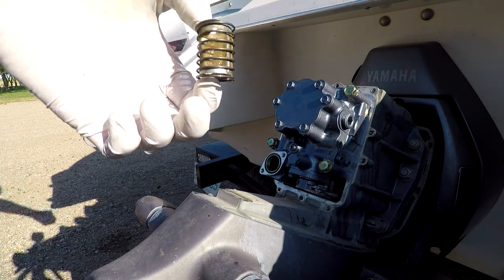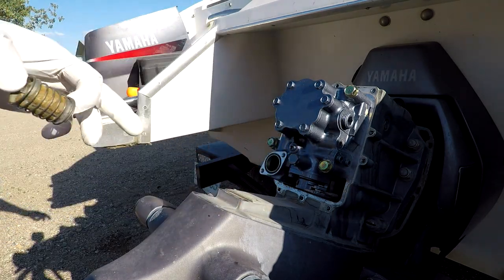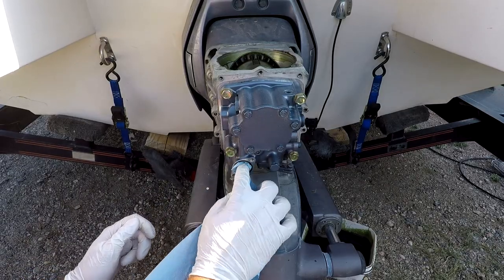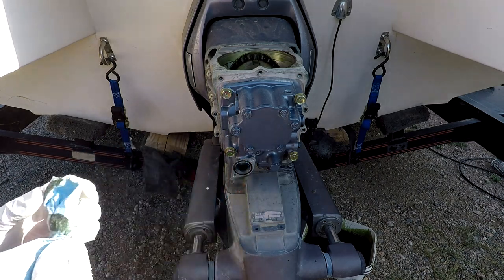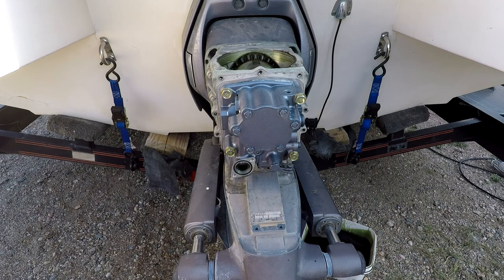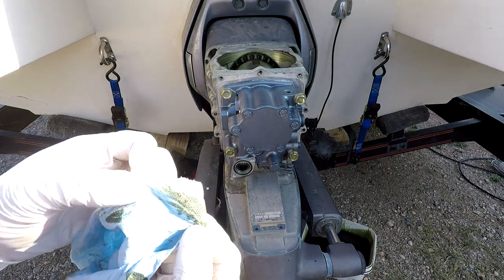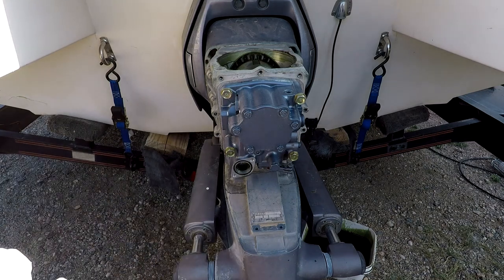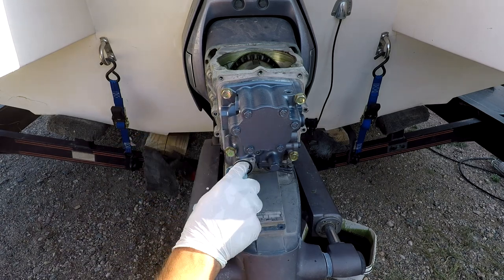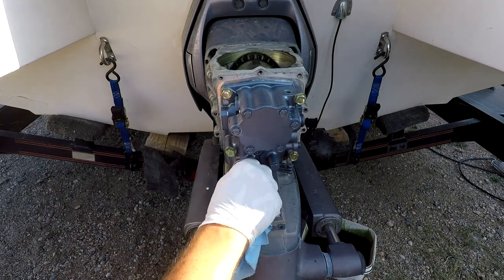You're supposed to do that every time you change the lower leg oil. In the bore there's some more residue, so I'll put the leg down a little bit and hopefully not drop too much fluid. I'll clean out everything I can find in there. There does look like there's a little bit of brass shavings — not sure what is brass on the internals — but something's wearing a tiny bit. They're not big chunks though.